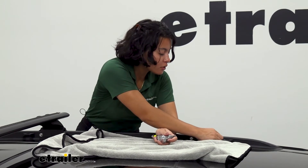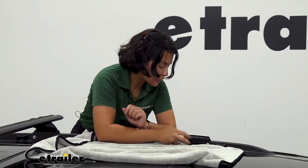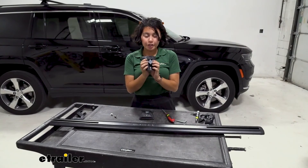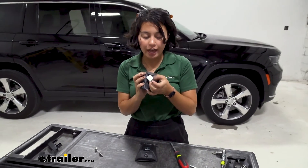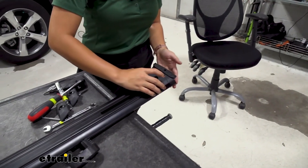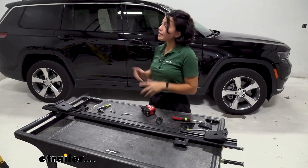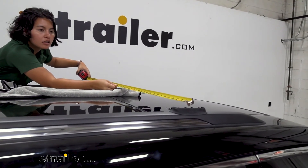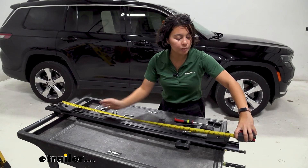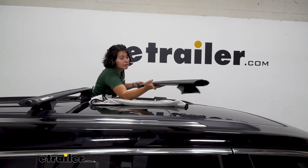You can hand-tighten the bolts, but I use a 3/16 hex bit for easier tightening — just make sure you don't over-torque it or you'll feel the flush rail bend. Then get your towers and set up your crossbar, which should already have the plate on it for sliding into the crossbar. Measuring things out and tightening in the right order is the trickiest part. The mounting holes on the roof are 42 inches apart center-to-center, so match that with your towers — make sure they're 42 inches apart center-to-center — then tighten the towers to the crossbar. Set the crossbar and towers into the brackets.